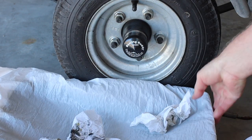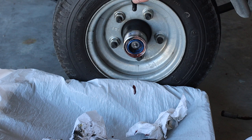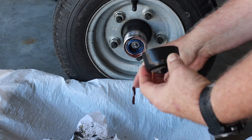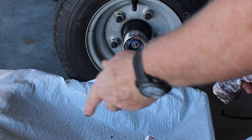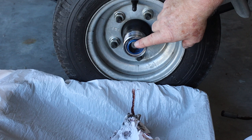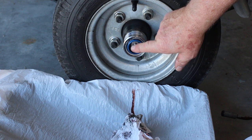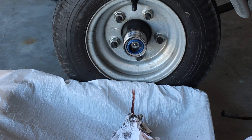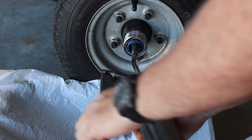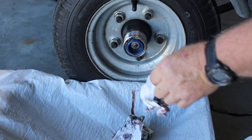I'm going to put this underneath here and pull the cap off. That's why I did that underneath here — because this is submerged, it sometimes gets water in there and the water will mix with the grease that's in there and cause a mess like you see there. I'm going to clean this cap as best I can and clean the front of this, the bearing buddy. See this blue ring that pushes out when it's still full of grease. Now if I watch the blue ring, see it's starting to come out — there you go, that's enough. Clean this off.